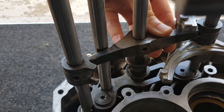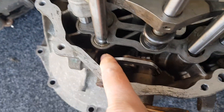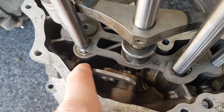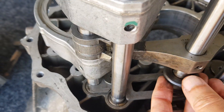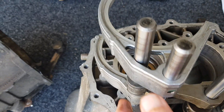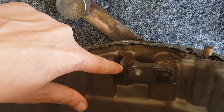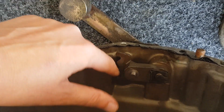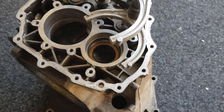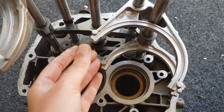That's moved by a ratchet, and this is spring-loaded so that it only stops at certain locations — it has a detent for that. Then this whole section is moved up and down. When it moves up and down it moves the selector forks, and that is operated by this lever in here, which again has a detent — so that would be in the neutral position, then either first or second, third, fourth, fifth, sixth.